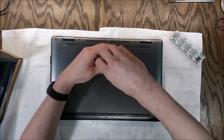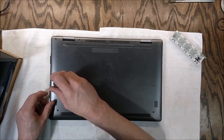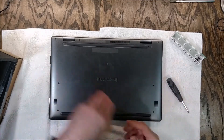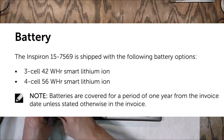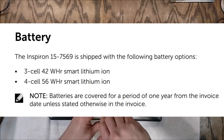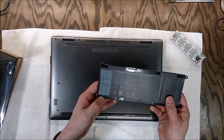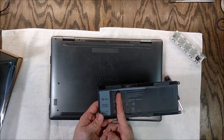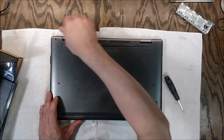Well, I think this model was actually designed to take either type of battery. If you search online you will not find anything anywhere that says the 4-cell battery will fit into this laptop from any of the battery suppliers. But if you look in the Dell service manual it actually says it ships with either a 3-cell or a 4-cell battery. I couldn't find exactly which 4-cell model to use, but poking around the internet and looking at other Dell laptops, this 4-cell battery with type 33YDH looks just like my 3-cell battery except it's this much longer. So I'm thinking that is the 4-cell battery Dell is referencing in the service manual.